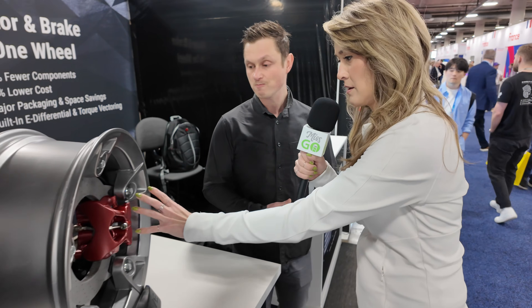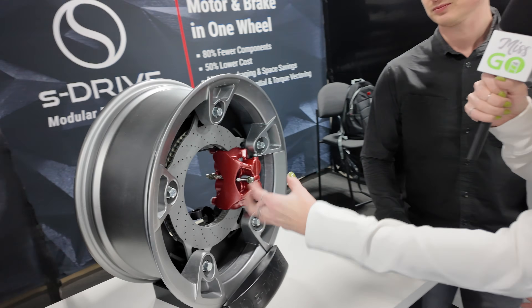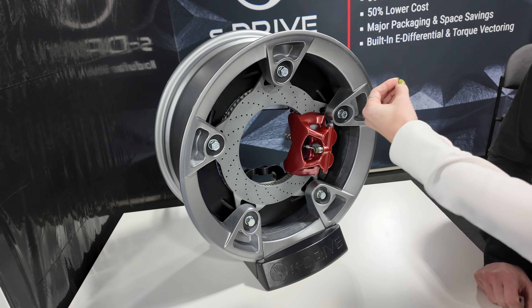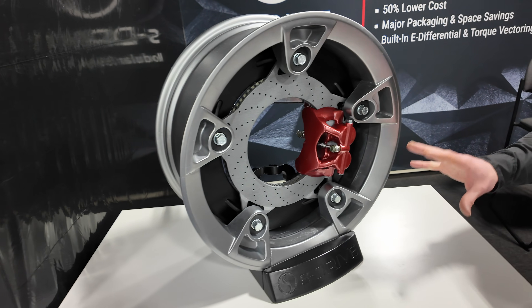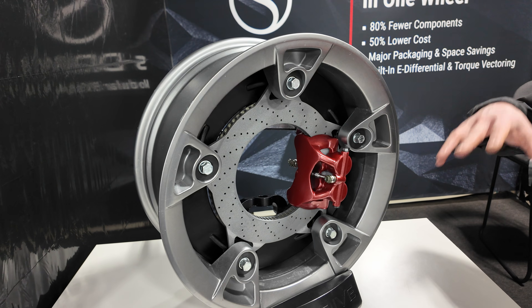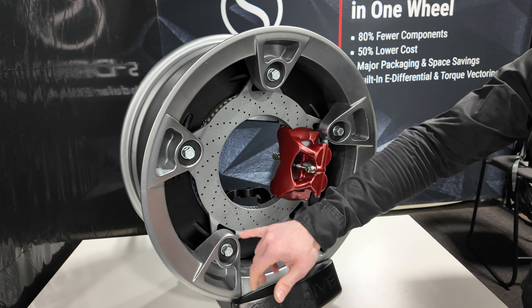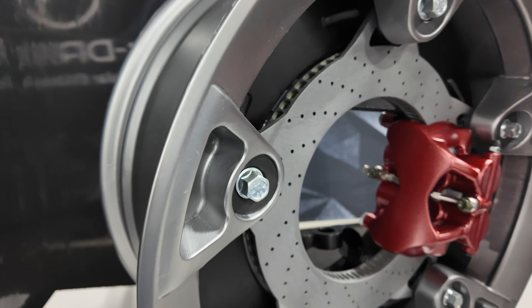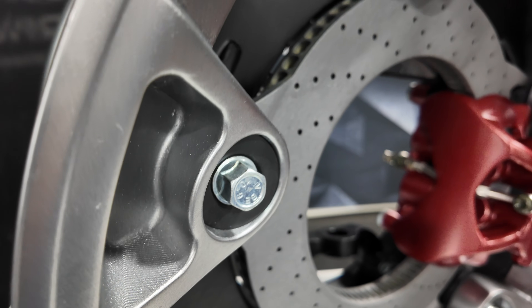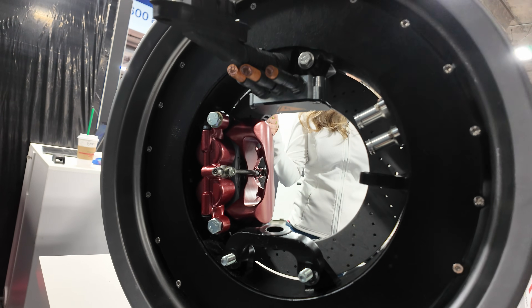It's kind of interesting because with this design it's all built in here — you have the braking system and the caliper, and then you have these hex bolts. The damping from the motor spinning is transferred through those dampers. This is a 19-inch wheel designed for a race car, so there isn't much room for damping, but for production vehicles we'll have slightly more space. Those black rings represent the damping elements, which give a little bit of damping so we don't put vibration on the motors. This way we reduce the stress on the bearings to improve durability and increase the lifespan of the product.